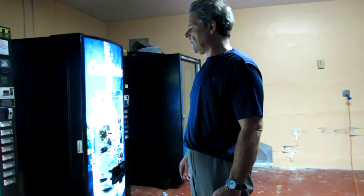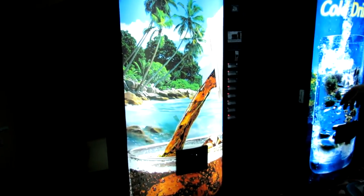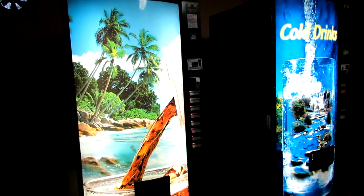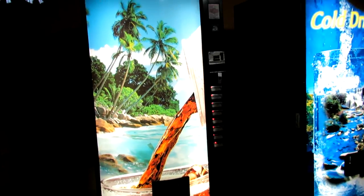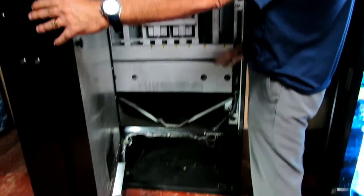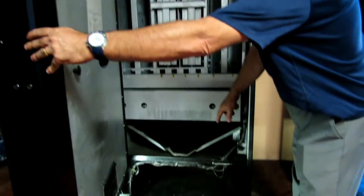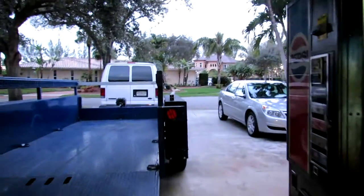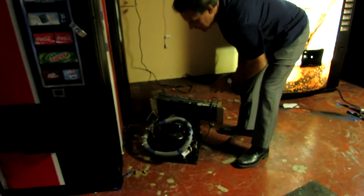Now this machine here I'm a little proud of — this one I refurbished. I painted it, I changed the buttons, I made sure all the sold-out switches were working. I'm getting pretty good, and I finally found a paint that is fantastic. Even on the inside I cleaned it up. The compressor I'm going to be putting in is one I bought myself. I put foam around all the tubes to keep the cold in, and also so that if it vibrates and hits metal it doesn't open up a hole.